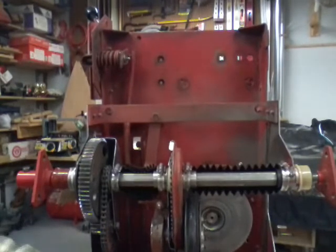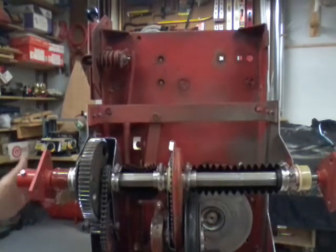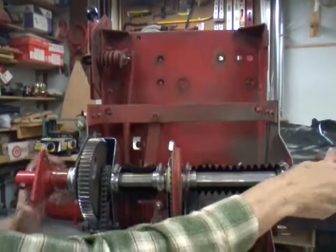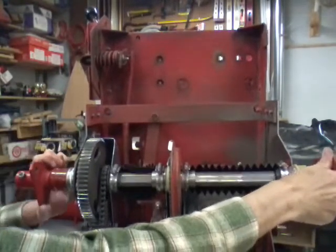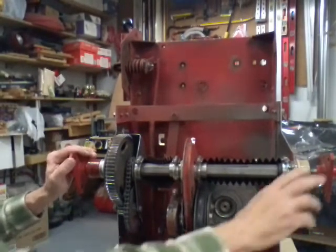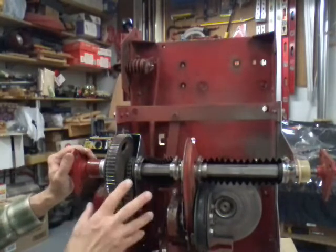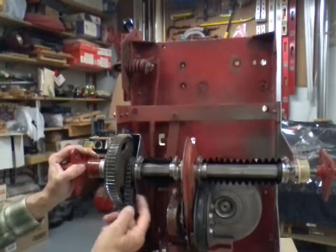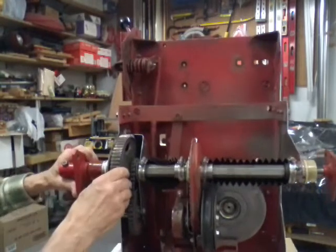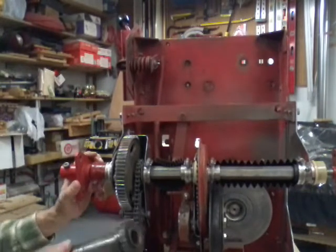First you've got to put it in neutral. I got a block of wood I can shove in here — it should turn the drive train if you can turn it hard enough. Now if you're turning this and holding this tire and that doesn't turn, something in here is broke. It could be your chain, it could be the chain in your chain case, or it could be this short axle.